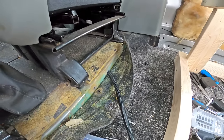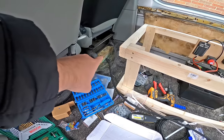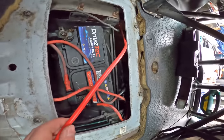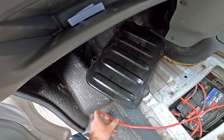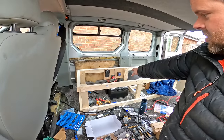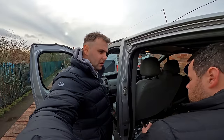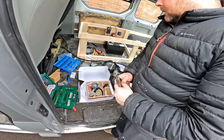We've managed to drill through that piece of metal and got the conduit through. The wire that goes through the hole we've made in the chassis comes through to the bottom of the battery compartment. We're going to fuse this here - in the kit you get a fuse holder. It has to be fused at the vehicle battery end, pre-split charge relay, and then there's also a fuse post-split charge relay. These are failure points for safety - if the current exceeds the fuse rating, it just pops the fuse and protects your system.